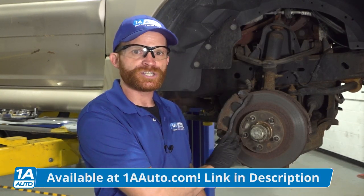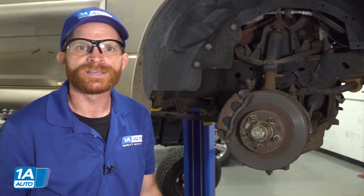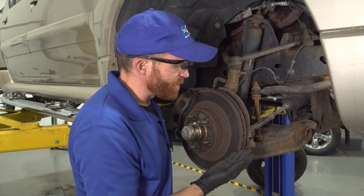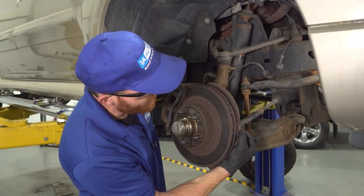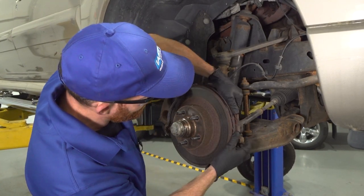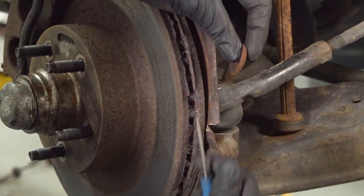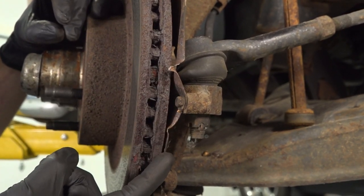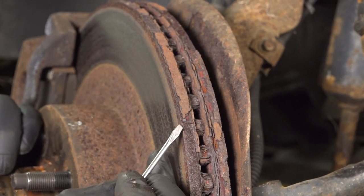We've got one of these rotors in front of us and the brakes are in very poor condition, which gives me a perfect opportunity to talk about braking issues that can cause noise. Starting simple: spin the rotor and see exactly where the noise is coming from. For me it sounds like it's coming from the backing plate, and I can see it's pretty much pressing right up against the rotor. Other issues you can find with your backing plate: it's either damaged or peened over and hitting up against the rotor while it's spinning.